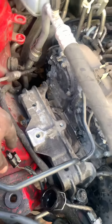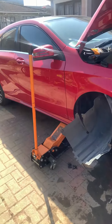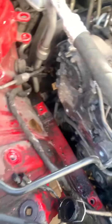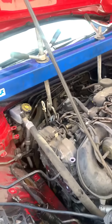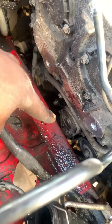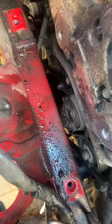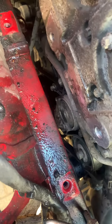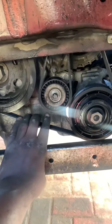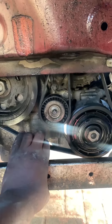Now this one must come out since the big one is out. Day two of the service, almost done. We just need to change the serpentine belt — we had to take out all of the mountings and prop up the engine so we could reach the tensioner. The tensioner is over there and it's got a little hole there to lock the pin, so we're going to lock it just now and change the serpentine belt. Pull the serpentine belt from here, pull it down so that the tensioner can align with the hole.